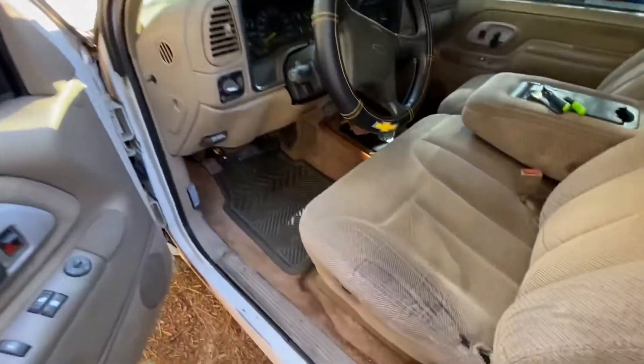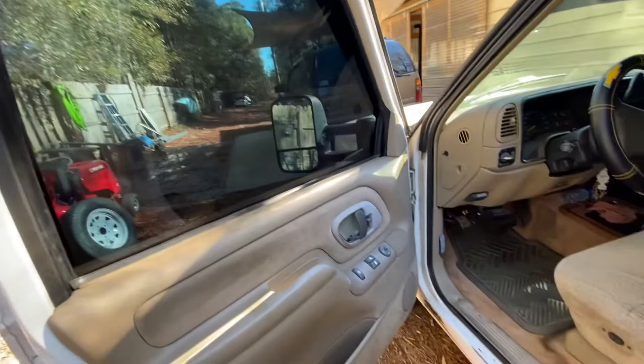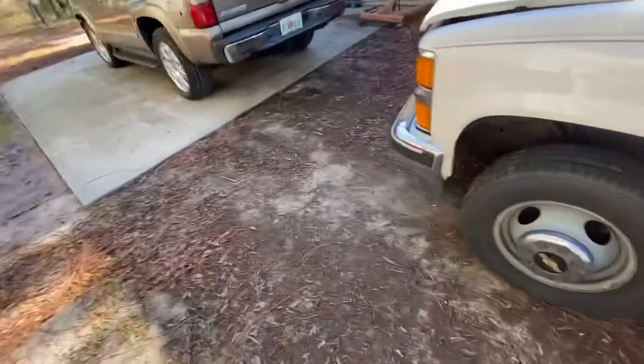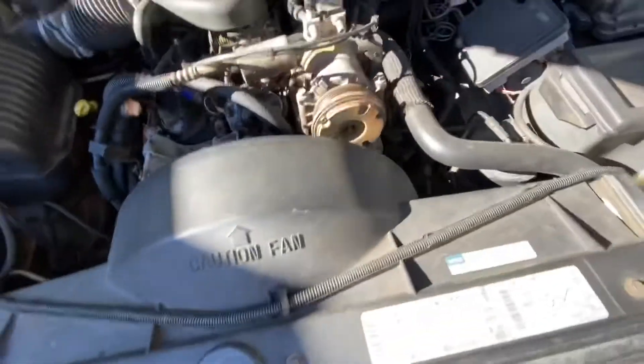Got it up to the shop. One important thing to always remember when you're about to embark on an engine swap — if you got power windows, make sure they're up. Almost made the mistake. Have made the mistake a few times. It usually doesn't end well, depending on how fast you're going to get it done.